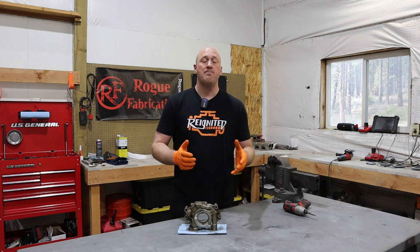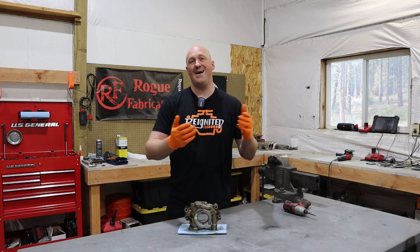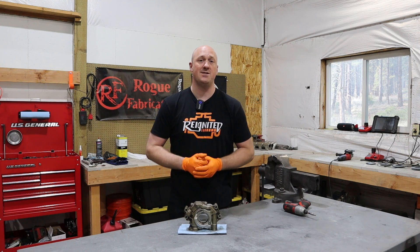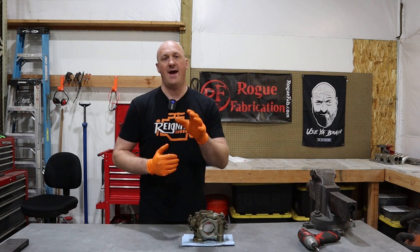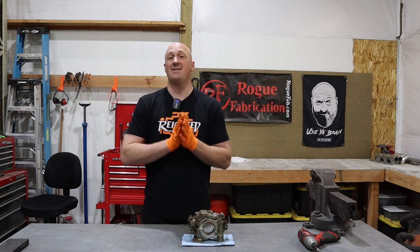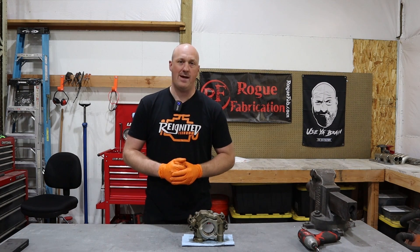At the time of that video, I had not had a chance to test either a 6.4-liter truck engine or a 6.4-liter SRT engine, so I couldn't verify whether the Hellcat pump is an upgrade for those engines. Now I have those answers. Some months back at work, I had the opportunity to replace a 6.4-liter truck engine and was able to measure the oil pump gear rotor size. Interestingly, it is the exact same size as what comes on the 5.7 engines — in fact, I believe it's actually the exact same part number. So the 6.4-liter truck engines can definitely benefit from this upgrade to the Hellcat oil pump.